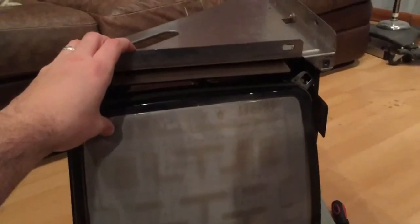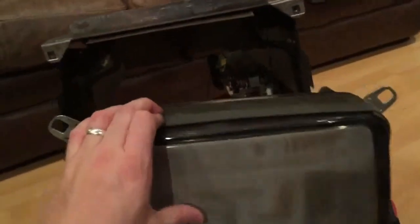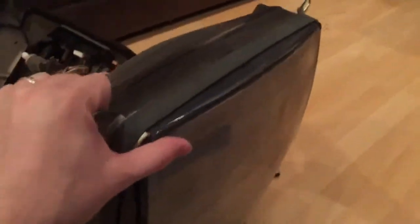Now the last thing we have to do is actually unscrew these bolts that hold the monitor on. Once you pull those bolts out the monitor is going to just slip out pretty easily. You can see here the bolts have been removed — I'm just holding it in place — and you can carefully hold on to it and let the back just kind of fall out. Pull the monitor away.